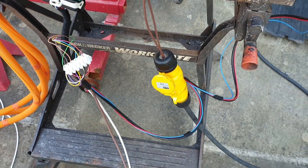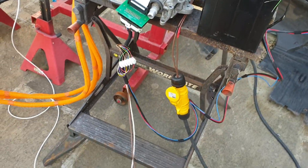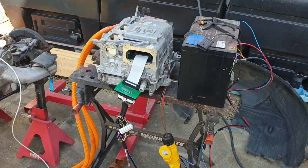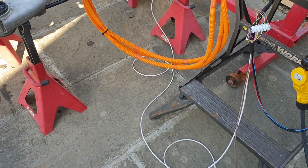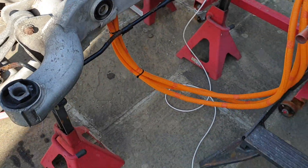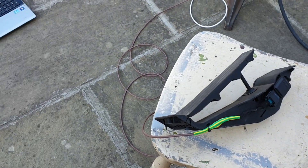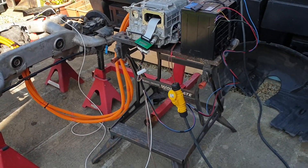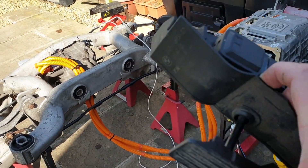We're using MG2 on that Yaris inverter to provide our three-phase power, our signal cables, DC coming in, and just a 12-volt battery to give us 12-volt power for our inverter. The white wire there is just going to the resolver and temperature sensor. Over here we've got our normal BMW throttle pedal, and yeah, it just basically works.